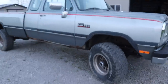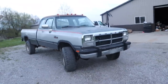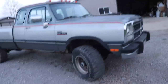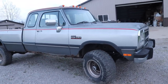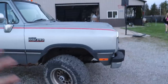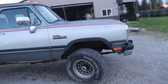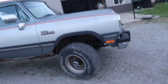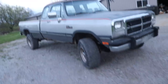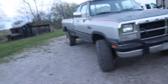It's pretty evenly cut on both sides - it's a work in progress but it's going to be fun. In terms of the purpose of cutting these fenders: we cut them to fit 35-inch aggressive mud terrain tires. They're a little bit wider and about four inches taller, so we've got to make space for them to fit. I think this is going to do the trick - we should have enough room to clear on the stock suspension.